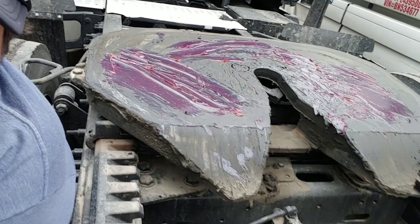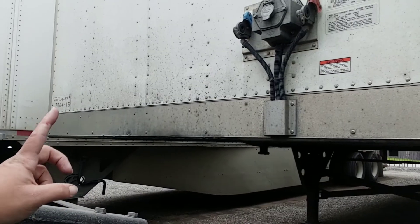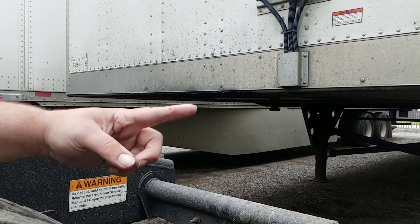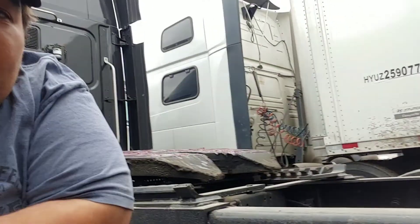You've got to make sure to grease your fifth wheel at least once every two weeks, depending on how much grease you put on it. Some people will say a month, some people will say a week. It just depends on how long you've been connected to the trailer and how much grease you put on it. As you can see, this is how I put grease on it — very liberally. There's plenty of grease on it. So when I connect back to the trailer, all up underneath here will have grease on it. Today's a good day to do it. I might go ahead and back up underneath the trailer now. It's supposed to rain a little while, so I probably don't want to leave it where the water can wash it off, because that would just defeat the purpose.